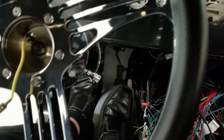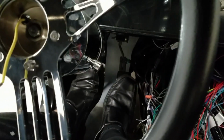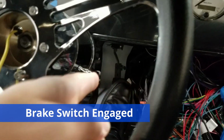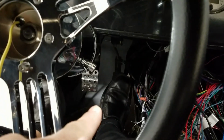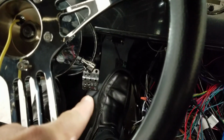Anyways, here I am starting to drive this like a clutch, slowly giving it gas while pulling this off. Well, that meant that the 5 volts is still triggered, and it's triggering the computer to not work. The next part is, once you pull this off and you've already applied gas, this is not going to reset until it hits full zero.